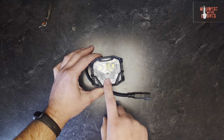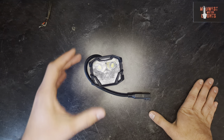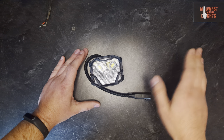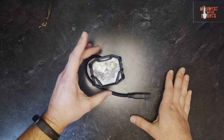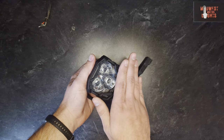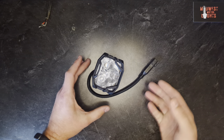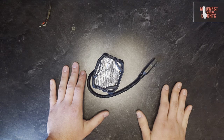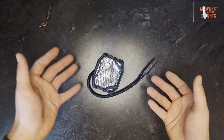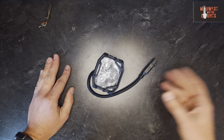Part of that is because it only uses three LEDs. However, it does compete with the four LED models — hence the name Four Banger. A lot of the reason for that is heat management. LEDs make a lot less heat than incandescent or HID halogen options, but when you're driving them this hard, they still make a substantial amount of heat. With the heat sink Morimoto designed and only using three LEDs, it's able to drive them much harder for much longer and produce a lot more light than many competitors do after 20 or 30 minutes. A really bright light at the start doesn't do you much good if it's not that bright half an hour later down the trail.